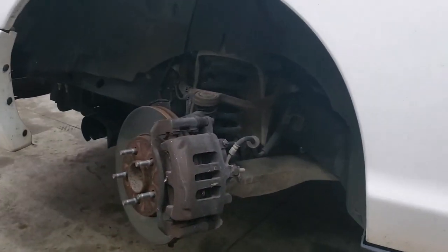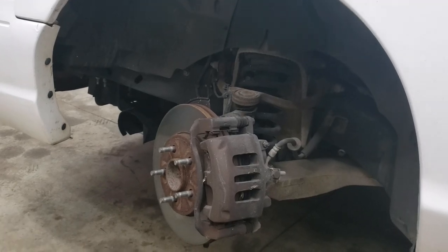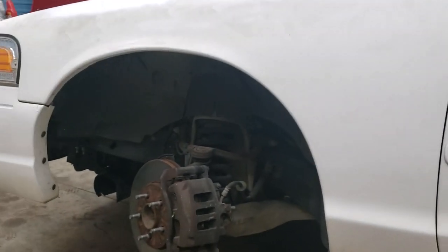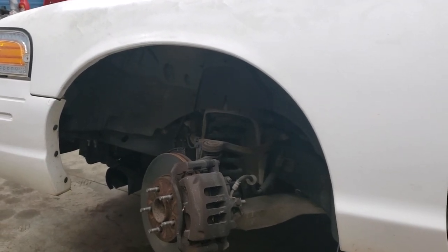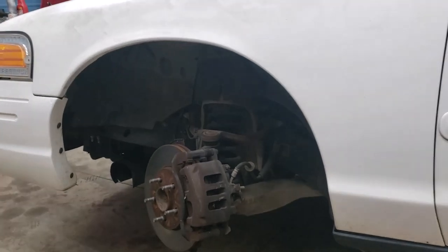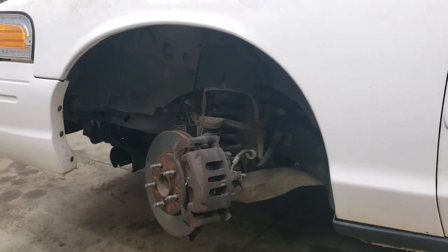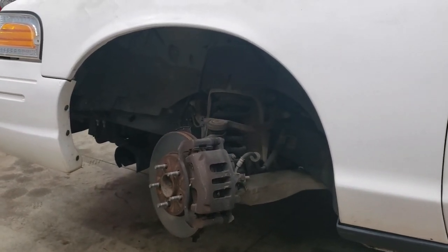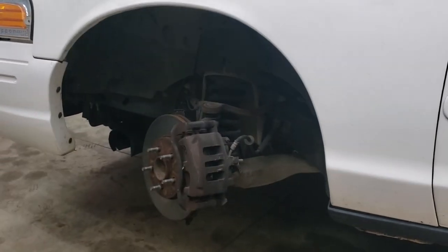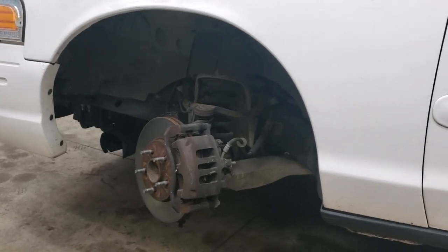Like this car — we may upgrade the rear end because the gearing on these were highway gears. Originally I thought about 3.73s, but I'm thinking more like 3.55s. Or I'm thinking about pulling this automatic because I drove it today to test it and didn't like some of the things it was doing — driving perfect, then a little funny, back and forth. Until I have my lift put in my shop, we'll drop the pan and look inside the transmission.